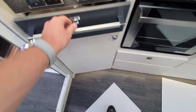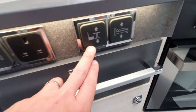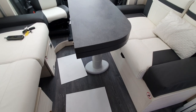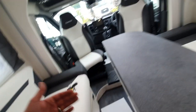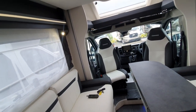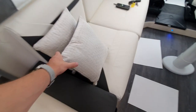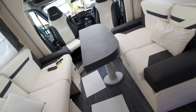The drawers have plugs in them and also controls for the beds. We have one control for the table. Making sure it drops cleanly without fouling on anything, if you're going to use it as a foreberth we open the table and it sits on these rails here. We then use the pads from the back to sit in at the bottom to make a big double bed. We drop the beds halfway down and can use that as a foreberth. If there are just two people, you can drop the beds all the way down — making sure things like cushions are moved first, because it will break the bed if something fouls on it.